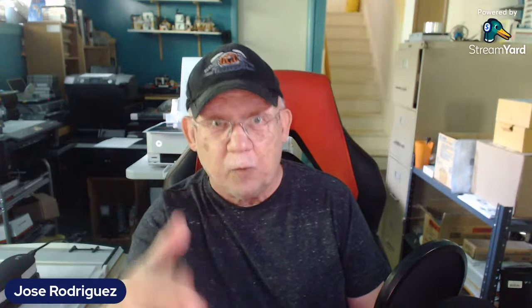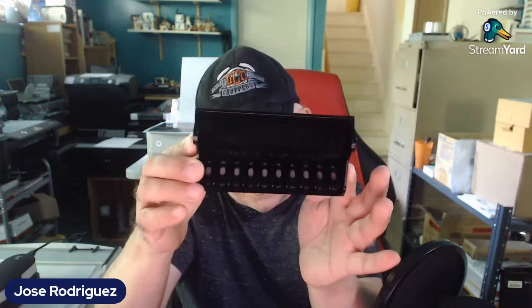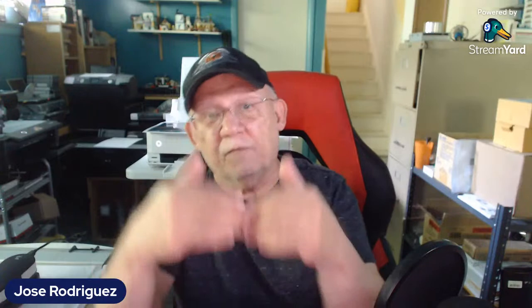On printers, and I've got this sample printhead here, actually got another one, I put it over here as well. So these printers have this style of print head. This is an 8500 Canon printer print head. The cartridges sit like this. And this whole unit with all 10 cartridges travels back and forth, laying a pass of ink, paper advances, another pass of ink, and they overlap depending on your quality settings or not. If you're printing quick on plain paper, there's no overlapping. It's one pass, advances a specific amount, the next pass, and it matches perfectly. No banding, no overlapping, no gaps.